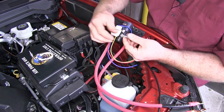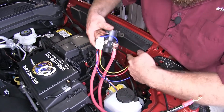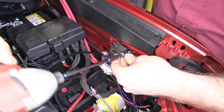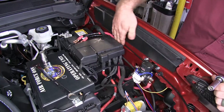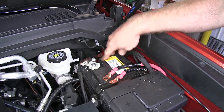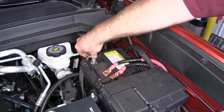Or you can mount it to something plastic and use the nuts and bolts to do that. It comes with a white wire with two terminal ends in order to ground it separately to something metal. We will be mounting it right here. I'll take my wires and feed them in the direction I want them to go towards the battery, then get it lined up with those holes and install my self-tapping screws. I'll just route the battery wires along the side of the battery and keep them tucked away. Before hooking up any terminals for our positive cable, we'll need to remove the negative battery cable so that we don't have any sparking accidents. Take a 10-millimeter socket, get that loosened up, and set it down to the side of the battery.